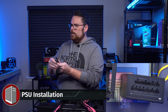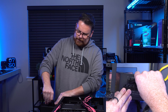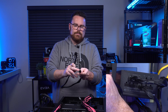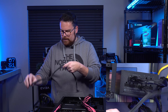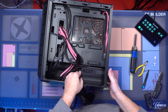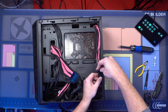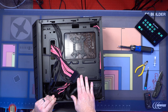Let's grab our PSU. They only go in one way, by the way. The ATX cable is going to go on top — it's labeled that way. This one is a four-pin connector. And then lastly, the cable you want to plug into the PSU — most of the time they're labeled, and this one actually says PSU on it. The CPU cable — the one that is split — is the one you don't want to plug into the power supply, just into the motherboard. Power supply is installed and screwed in, and now all our stuff is ready. Build is done.